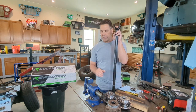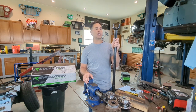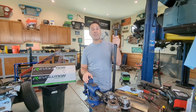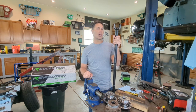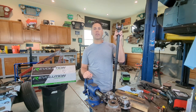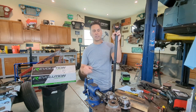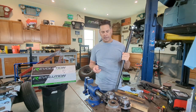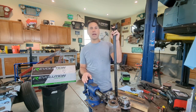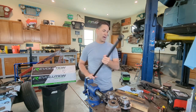Today I'm going to talk about axle shafts — specifically these Revolution Gear and Axle 4340 chromoly shafts. These are their Discovery Series, made in India, with a 10-year warranty. If you want US-made shafts, you'll need to go with the upgraded 4340 with 1350 U-joints. These Discovery Series shafts have a 30-spline inner, which gives a substantial increase in strength.